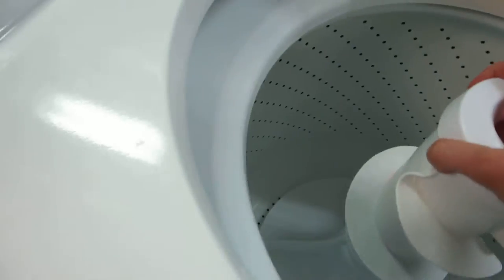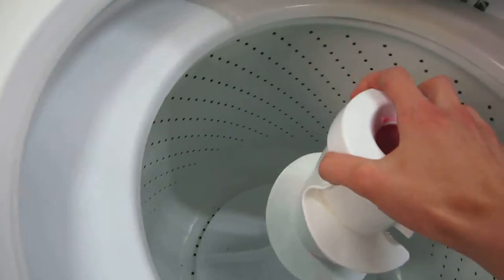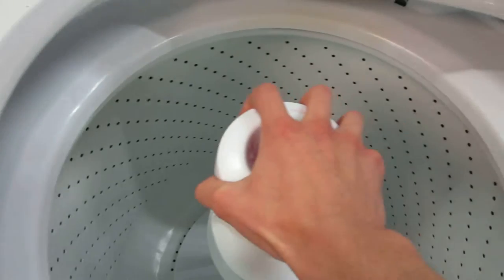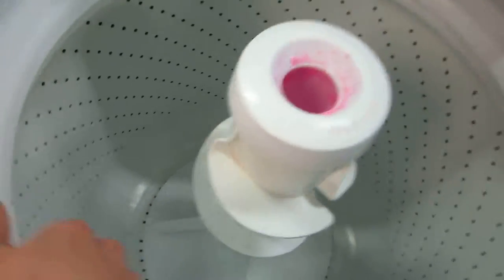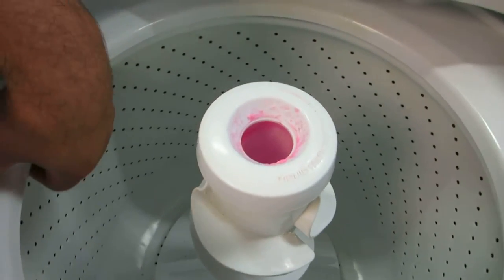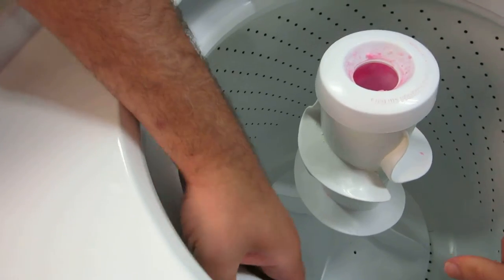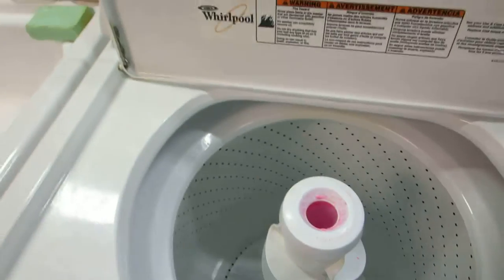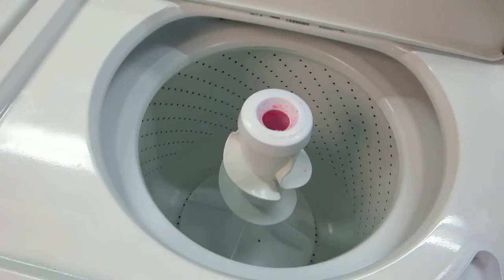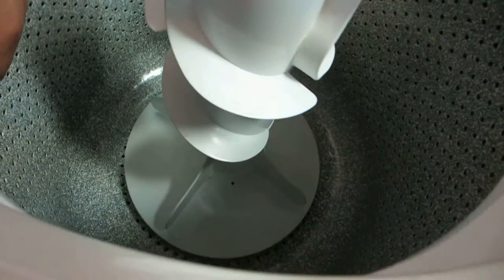It's not really banging around — the housing around it is just like every single modern washer. It takes a lot of effort to move this tub around, and when I try to spin it, it's got a tub brake. I can just barely move it if I try real hard. This tells you the tub is locked and secure — it doesn't need a lock on the lid just to start the load.